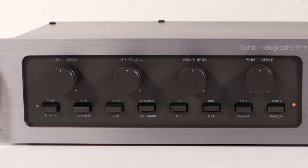The C1 has separate bass and treble tone controls for each channel with switchable turnover frequencies of 8 or 2 kilohertz for the treble and 40 Hz or loudness for the bass. These controls have been designed to provide maximum utility for the user. The dimensions are 19 inches wide, 3.5 inches high, and 10 inches deep, and it weighs in at about six pounds.